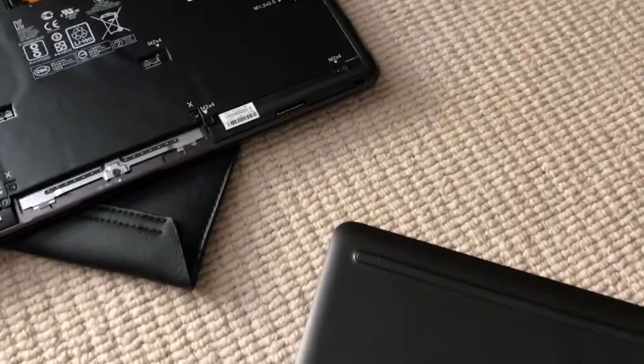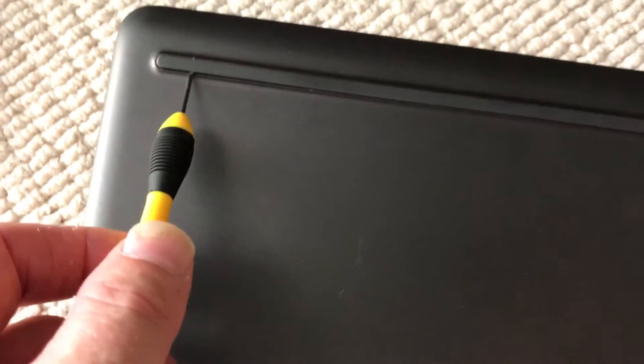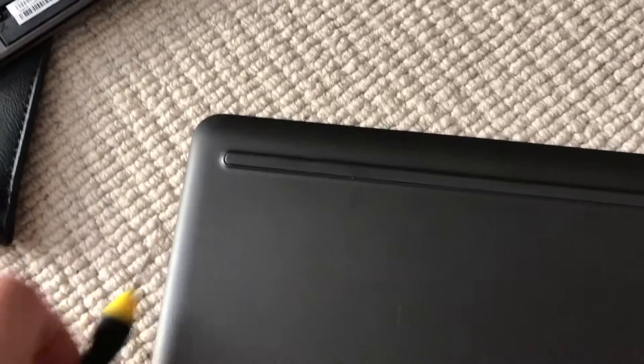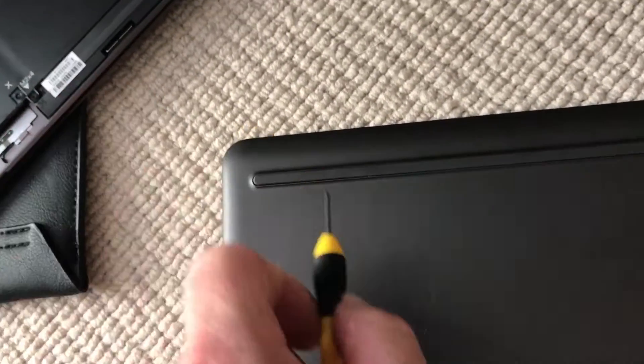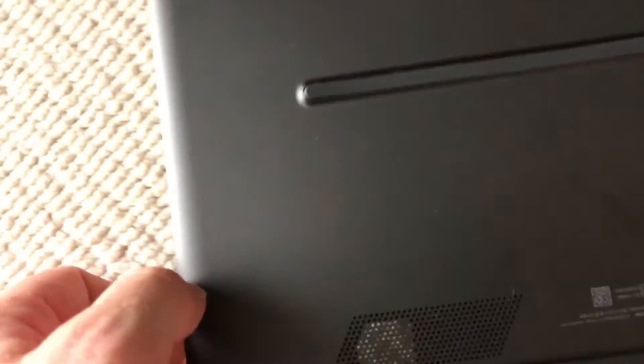I was a bit scared because it's brand new. What I actually did is I used a very small, really thin flat head screwdriver, and I just got in here. What I did is I felt along here until I could actually feel the little indentation, and then I just put the screwdriver in and peeled it up, and then just lifted it up slightly that way, put the Phillips head in, undid it, and pulled it out. I did start to think there was one underneath here, but there isn't — and as you can see, they're still absolutely fine.